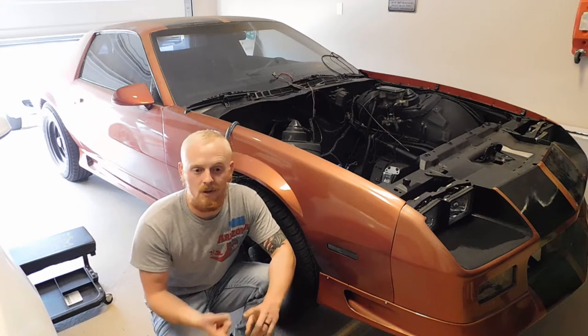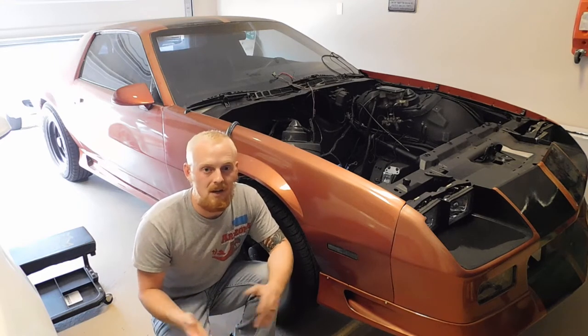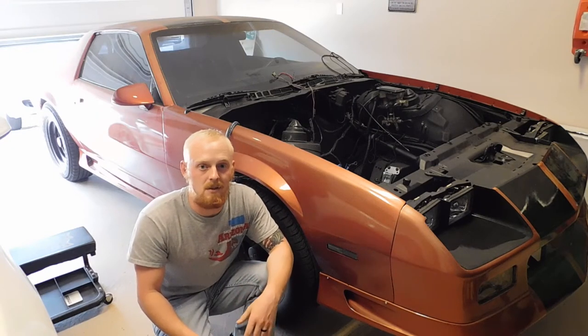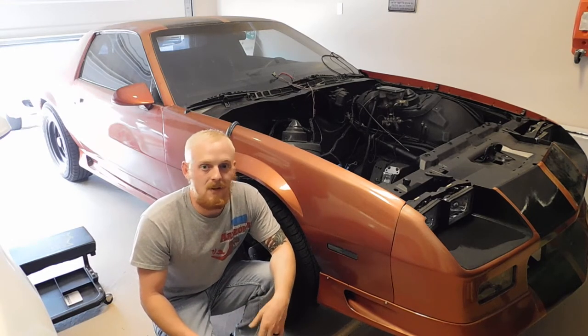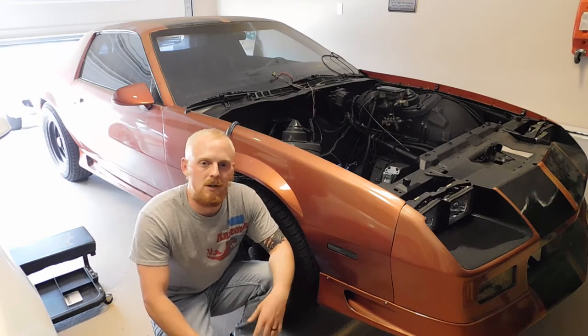There are many different noises — you could hear growling, grinding, popping, clicking, lots of different noises. Also keep in mind that it could be something besides the suspension: a worn motor mount, transmission mount, driveline, engine, transmission — lots of different things can make noises. It's really helpful to be able to tell what the different noises are and where they're coming from.